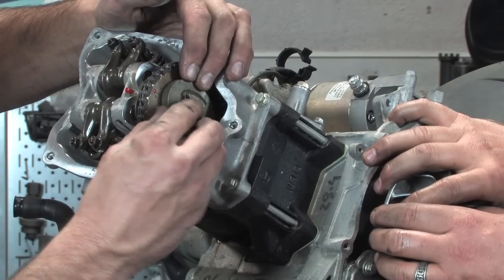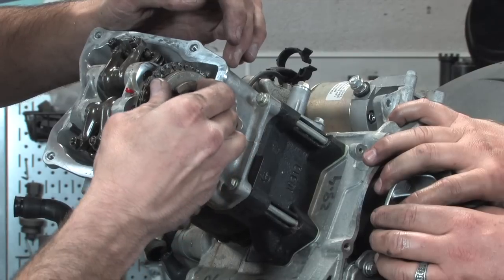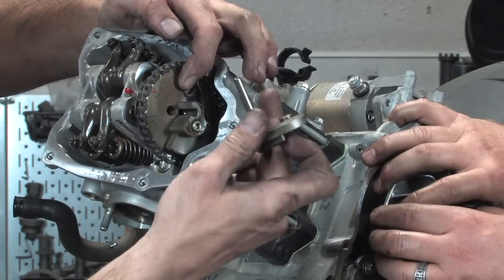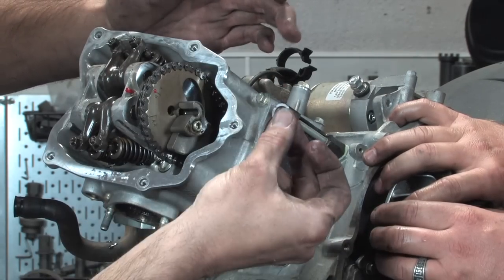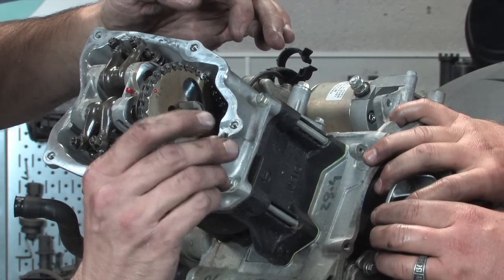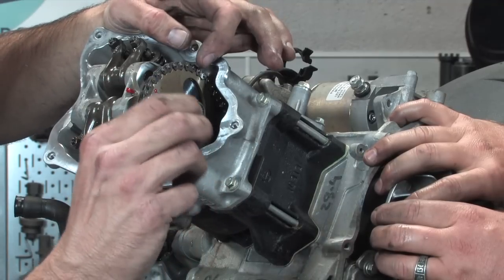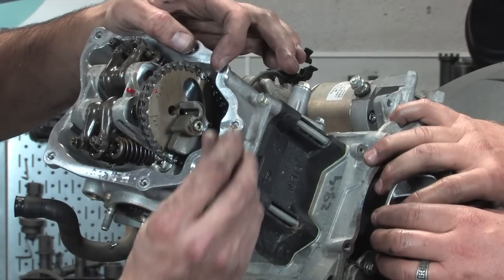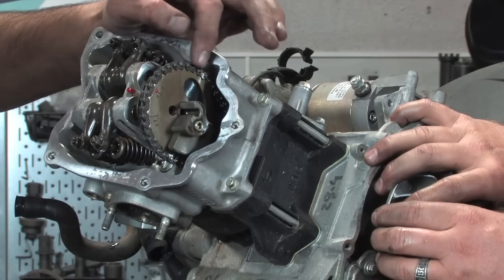Basically you've got this little spring. I'm going to go ahead and pull that off. I'm putting my finger behind here. The reason I'm removing that counterweight is that I was holding this little plastic spacer. There's actually a little problem with it. I see that it's been melted, and that's probably from extreme temperature. They normally look a little wider than this and aren't melted like this one. So we'll go ahead and replace that part. Little problem there with a motor that's been overheated.